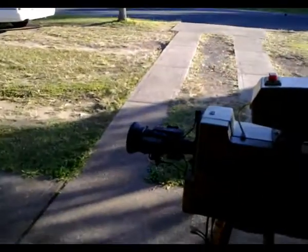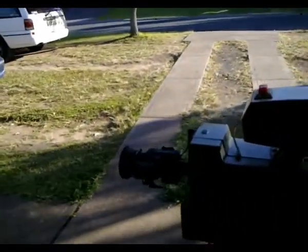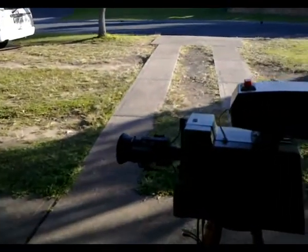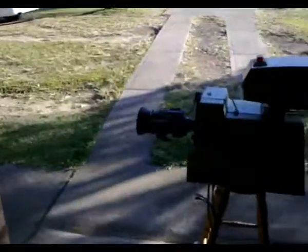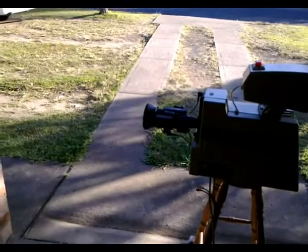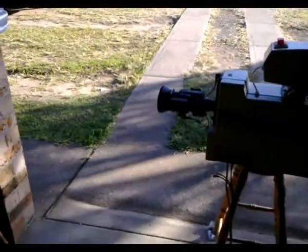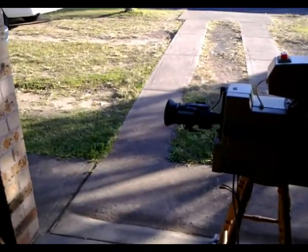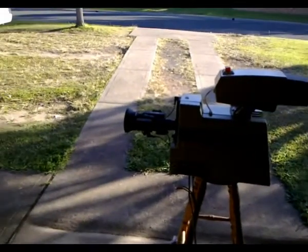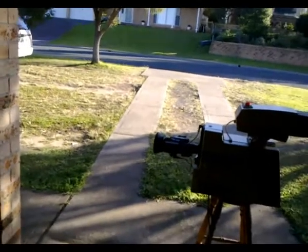Another thing I noticed when I've taken the panel off and pushed in the loose blue tube — when the sunlight is shining on the side of the tubes in their yoke mounts, it tends to have some kind of effect on the tubes themselves. I end up getting a kind of a vignette of a bright color — like a bright bar of green down below, or I might get a yellow-red sunburst pretty much dominating the picture.